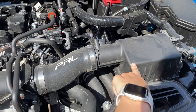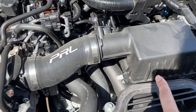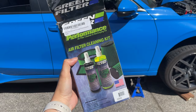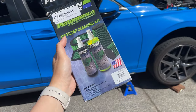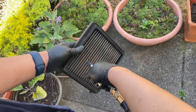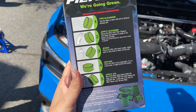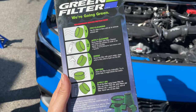One of the things you have to do for regular maintenance is clean your air filter or change it out. We actually changed this out less than a year ago, so we're just going to clean it for now. It is the PRL stage one intake — I was considering the stage two but it's kind of expensive. We're using this filter cleaner solution. We should have read the instructions because you have to let it soak and then dry naturally, so we'll wait about 30 minutes.